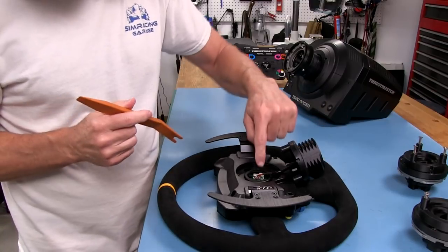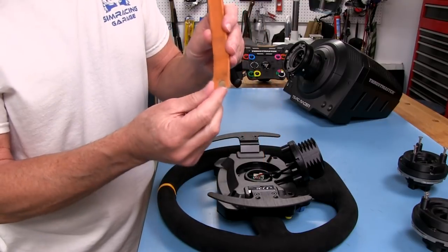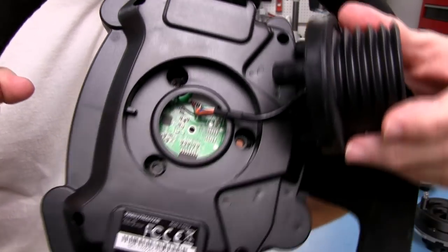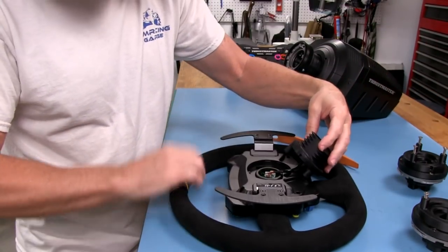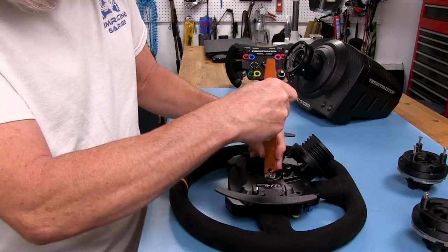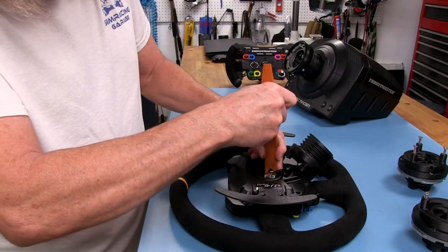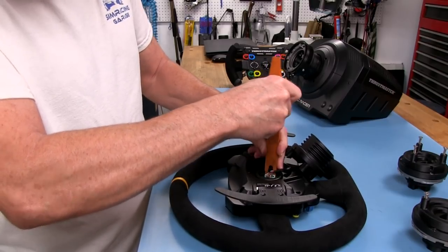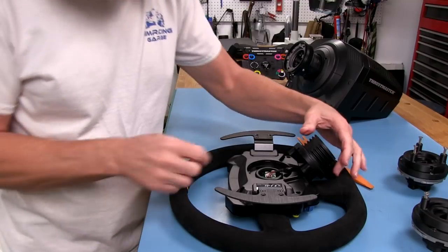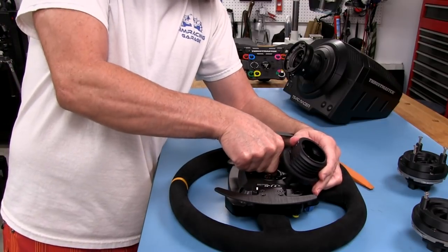I'm going to put this back down and use the corner as a little lever edge, then put these two prongs on a lip on this plug. I'll use the back of the casing as a little lever, just put a little leverage on it, very gently get it started, rotating back and forth. One side's tougher than the other, but we want to be careful not to mess up the board. I think I got it loose there — once it's loose, I get my fingernail back in and pry on the sluggish side. There it goes — just popped right out.